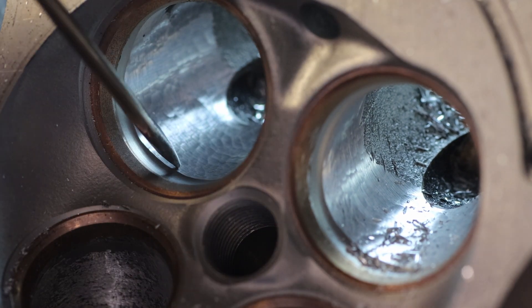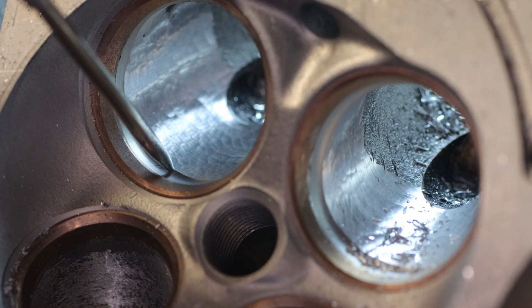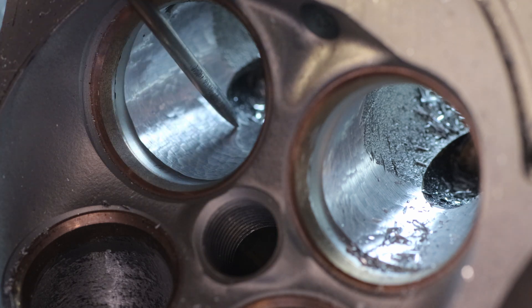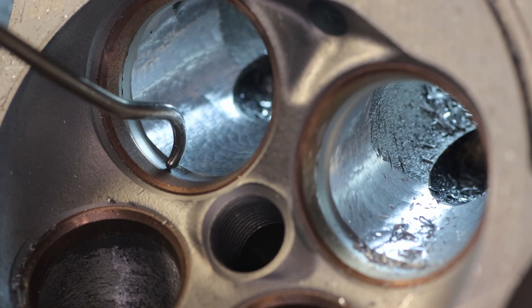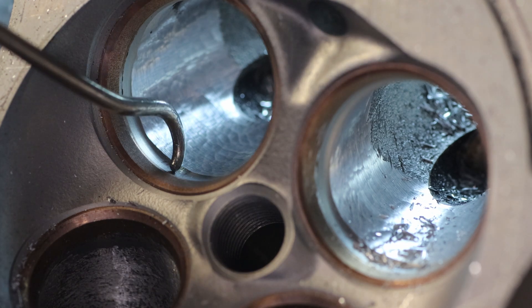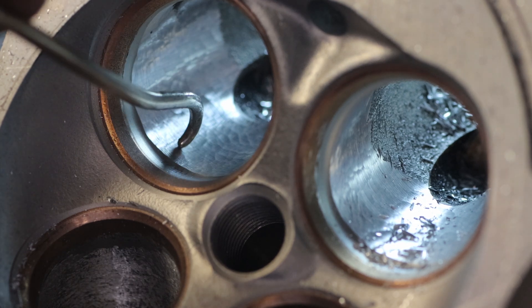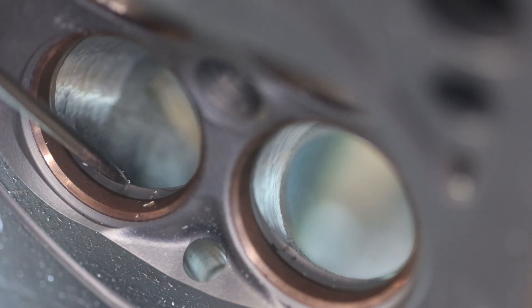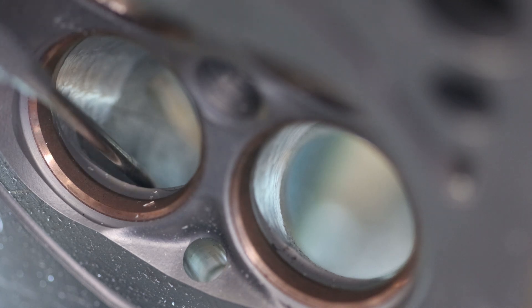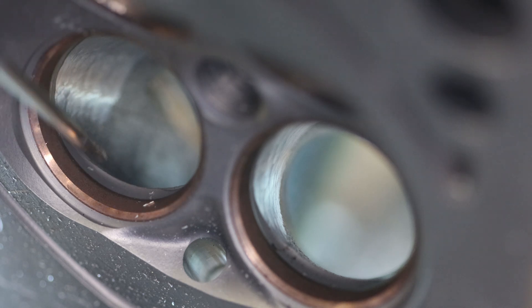Some of you guys are going to see that there is a ledge right here and I'm not porting it out. The problem is that it is on the angle that you're never going to get out. If you get it out, you're going to dig from here to here, and you're really not going to gain anything from digging — you're really just going to make it much bigger. If you go on the flow bench, if you did remove it, if you did dig all this out, you're going to make it too big and you'll lose more than you would gain by just leaving it. Now the short turns on the intake side have this big ridge here — it's a big ridge, and it's not turned anymore. So it goes from a turn and then hits this piece here. What we're going to do is remove this, widen this area here, and make this a complete turn right into the bottom cut of the valve seat.